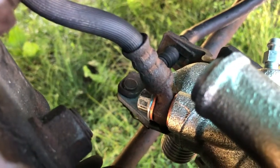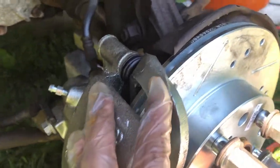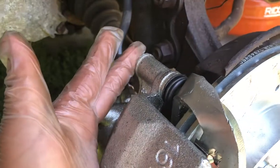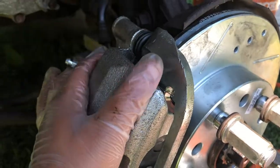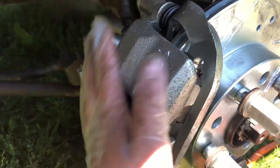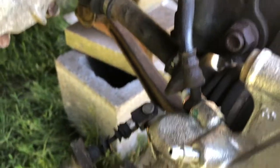The new caliper came with a new banjo nut, banjo washers, and all that. On the driver side rear it's the same concept. We were going to use the old bracket but it had a little dent on the slider pin, and the new caliper wasn't sliding in completely because of that dent. The OEM one fit perfectly fine, but because these weren't the same size it didn't fit, so we had to use a new one. I'm keeping the OEM driver side too — I'm going to restore the old one.